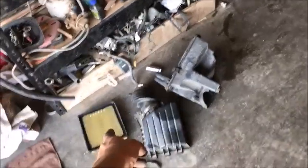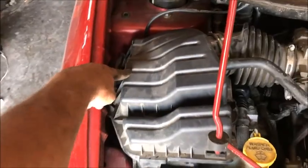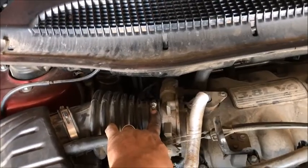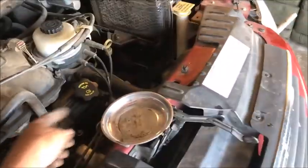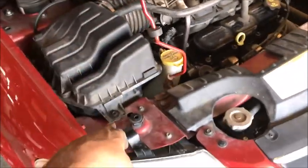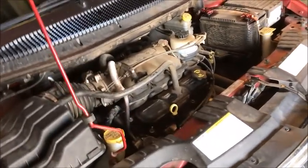Wish that had come out as easy! Let's get the lower box part back in. As I mentioned, this is the time to check that air filter — it's dirty, so we'll blow it out and recommend they get a new one. We put our 8 millimeter back in and tightened it down, the 10 millimeter tightened back down, the 5/16 or flat head or 8 millimeter — all three fit — tightened down, clip back in the back, and the PCV air hose to the valve. No bolts or nuts left over, so we did a good job. The tools used: 10 millimeter, 8 millimeter, 15 millimeter socket, and a flat head.